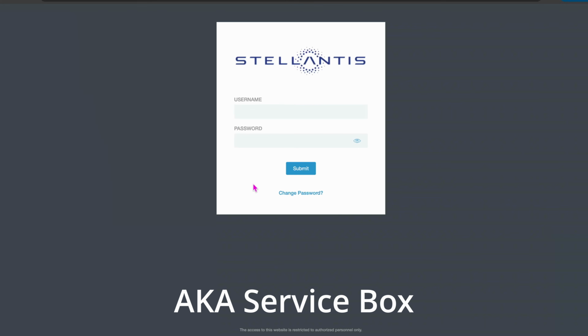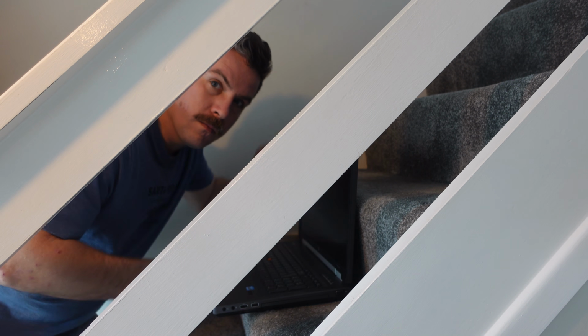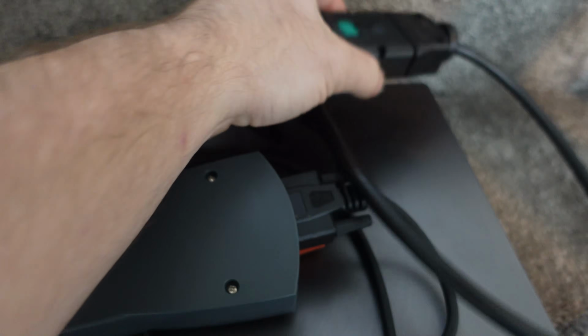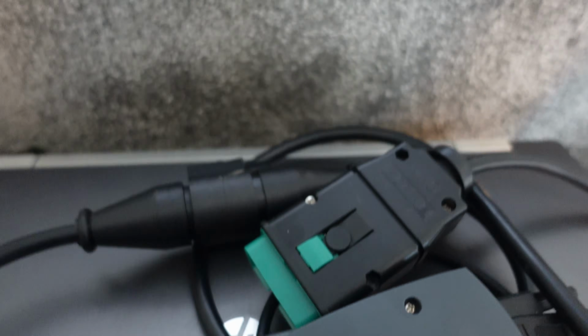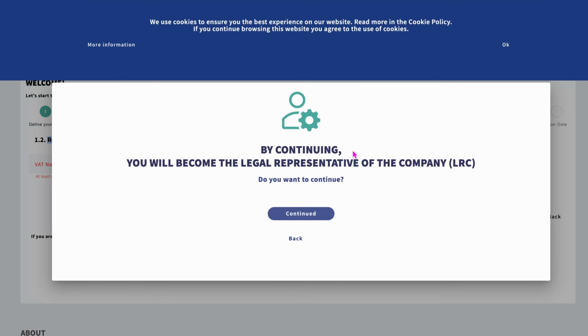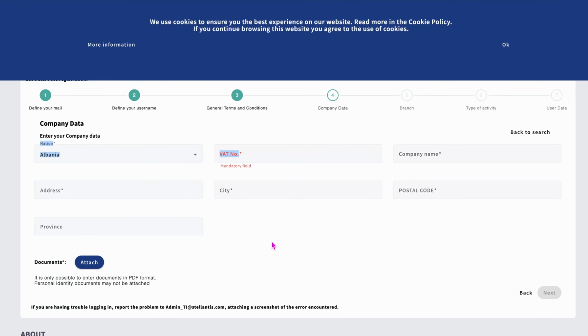Where was I? So you're gonna have to find somebody with Diagbox. This is the Stellantis software for diagnosing and coding vehicles. Now, there are dark places on the internet where you can get copies of this. And using a scan tool that you can buy from AliExpress, you can read codes on your own vehicle. Haha. But like most things, they've moved away from the local-based to online-based versions of the software for newer vehicles. This means that all those copies won't read the onboard charger of this vehicle. Damn it! Added to that, the software needs online access to code this vehicle's replacement onboard charger. This requires you to be a limited company working in the trade to gain access. Because it's such a specific software with costs, you're unlikely to find an independent garage who bothers with doing this.